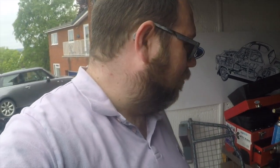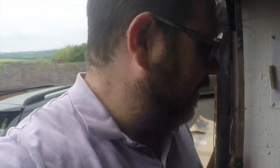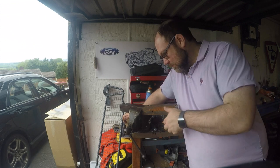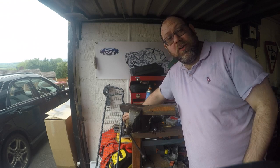The issue I've got is drilling a hole big enough without overheating the drill and the drill bits. I'm using step drills - a combination of my really big one and my less big one. The problem with the big one is the steps are too large so in between steps it doesn't have enough to grip into the metal, and the small one just gets really hot. I need to keep them cool and not blunt them. I'm admitting defeat on this one before I trash my drill - four mil steel is clearly too thick for the step drill, so I'm going to get a 25mm hole saw to do this job instead.